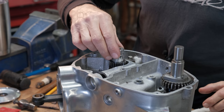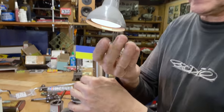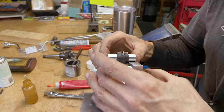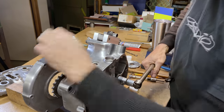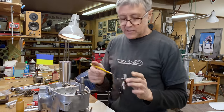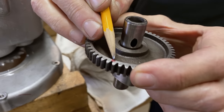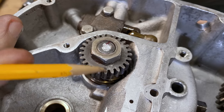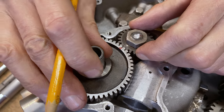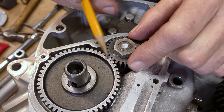Somehow we have to hold this. I made this holding tool for the cub — it's an old wrist pin, not a brand new one. About 35 pounds torque is my best guess. When you assemble an engine like this you have to look at the timing marks. Can you see here — there's a punch dot and I've surrounded it with red Sharpie, and then on the case there's a little indent right there. Those two have to line up. See how that mark lines up with that mark? That's how you set the timing.